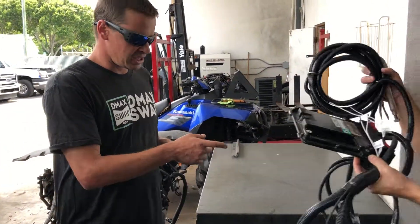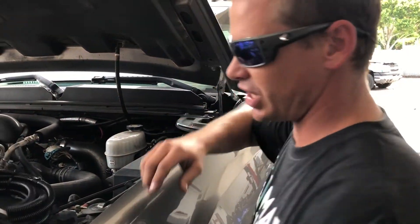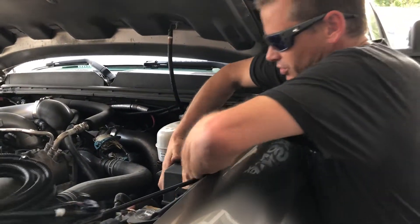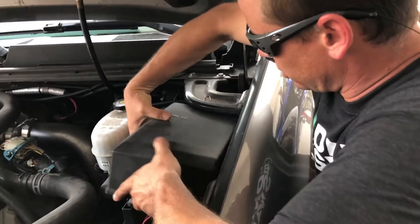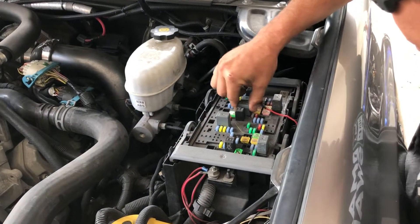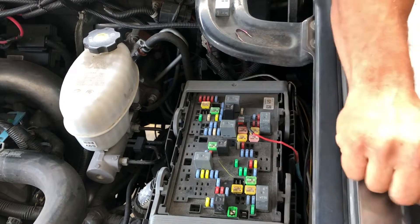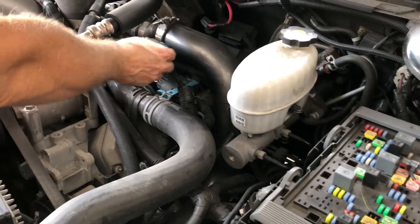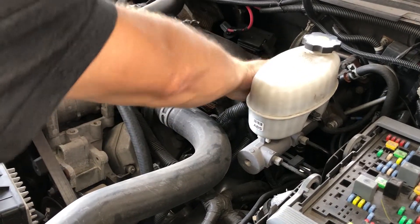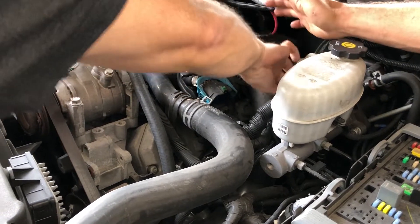So we've got the harness and the ECM and the fuse block attached to that. This system is designed to just run an engine only, not engine and transmission, so it only has the connections for the engine itself. What I'm gonna do is pop out the fuse block in this 08 LMM and access the starter relay so that we can use our magic starter switch. Since this was a running driving truck, I'm just gonna disconnect the existing wire harness and then plug in the new standalone harness.